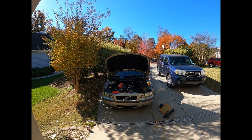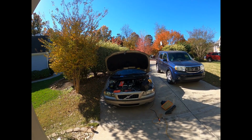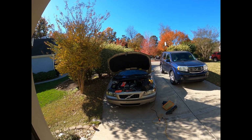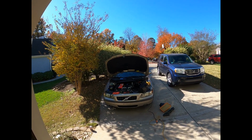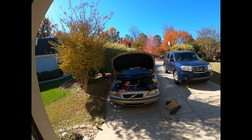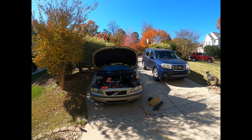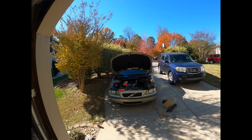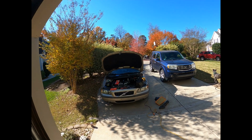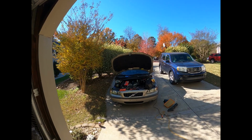The car has started exhibiting a symptom where it doesn't want to start. It'll just crank over, super strong. Battery's great, the starter's great, solenoid, everything engages. It just turns over, and it finally catches, maybe after 15 or 20 seconds of cranking. It doesn't do it all the time. It's intermittent. I can't figure it out. It's not a certain temperature, not a certain angle of the car. I tried putting the key on accessory to prime the pump. It just doesn't matter.